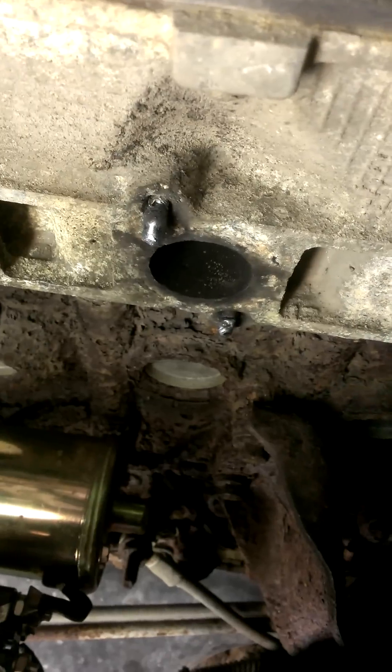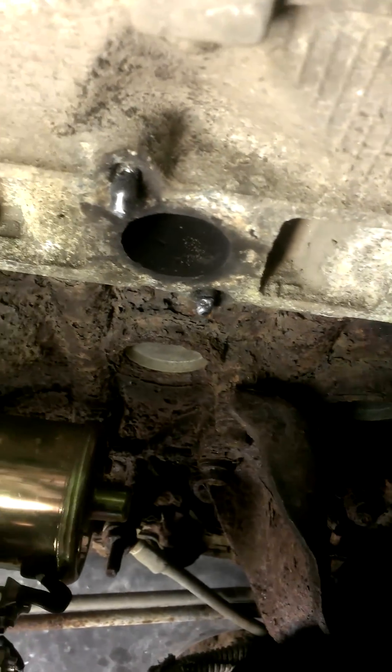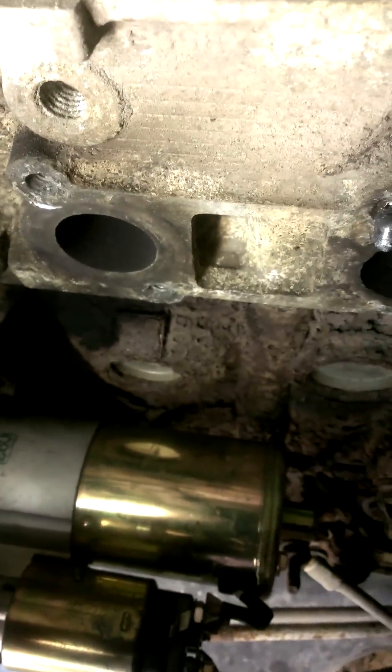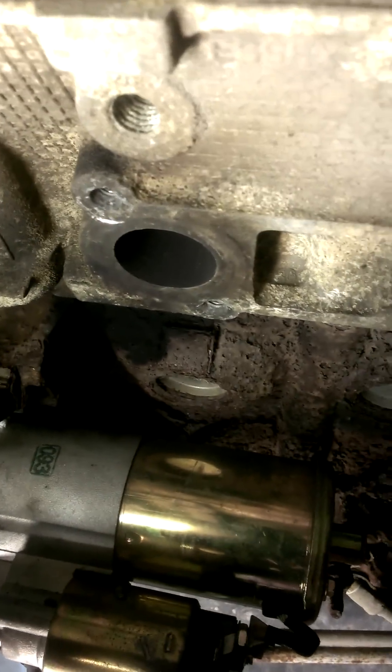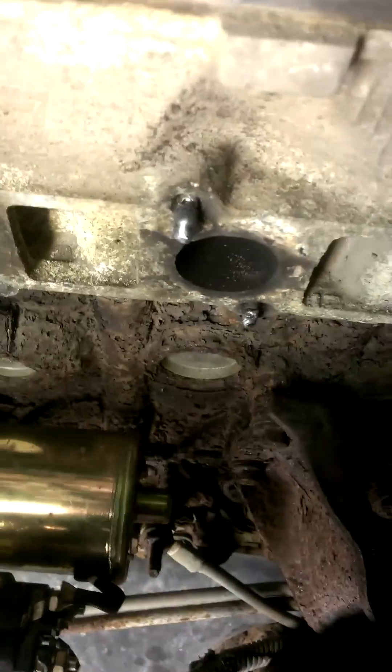What I did was cleaned up the surface of the stud and just put some weld on there, which allows me to put a pair of vice grips on there and slowly loosen it. I got lucky on a couple of them — the stud's still there. Basically, just be patient. I already got those two out. So far I have four more to go — well, eight.